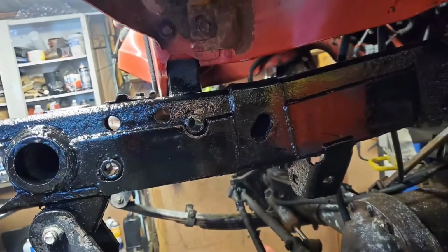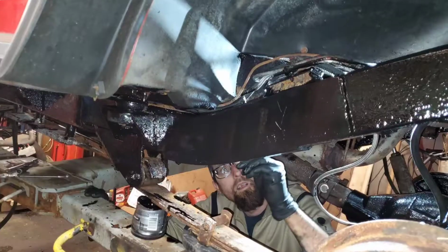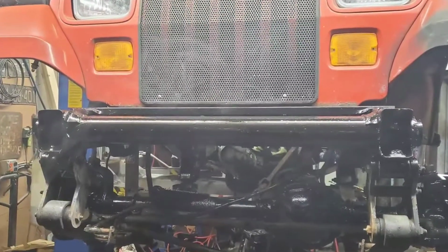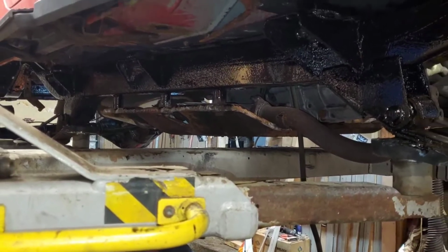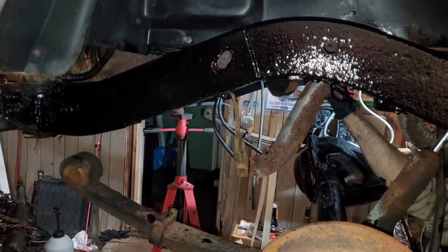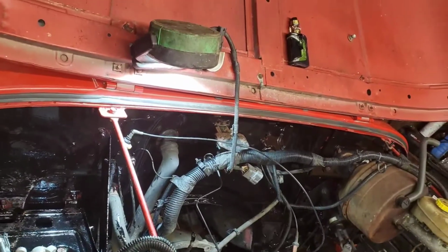There's the Por-15. I'm not a sponsor, but I'll tell you, it is a hell of a product. It encapsulates the rust, stops it right in its tracks, and it just looks awesome too. A bit of a pain to try and get off yourself or off your glasses or your beard. My brother got it on his beard and had to shave his beard off. I got it all over my glasses, so did he. And I'll tell you, it doesn't come off.